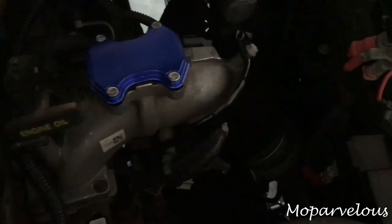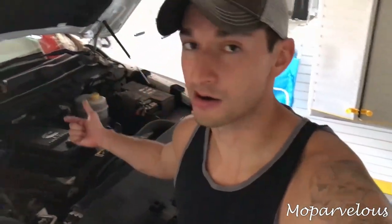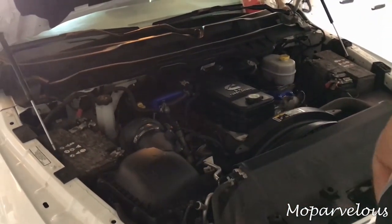On the side it's literally just the block off plate underneath the valve. I did not do a throttle valve delete — it's a common misconception that you need to. It's not wrong, but it's not necessary. When you delete the EGR, you do not need to install a throttle valve delete kit. Now that the emissions hardware is shut off via the tune and the rest of the EGR equipment is out, that throttle valve is obsolete — it would be strictly for aesthetics. The butterfly closing is no longer a concern because that intake of air is no longer necessary.